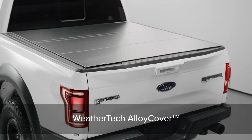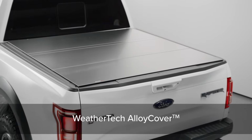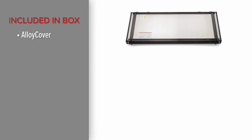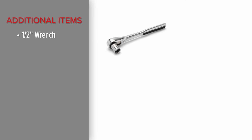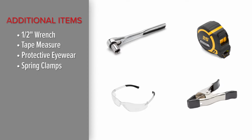The WeatherTech AlloyCover is a lightweight, low-profile truck bed cover that maximizes protection from harsh weather conditions. With your purchase, you should have received a pre-folded alloy cover, side rails, safety straps, and rail clamps. You will also need a 1/2 inch wrench or torque wrench with a 1/2 inch socket, a tape measure or ruler, and protective eyewear. Spring clamps may also be required.